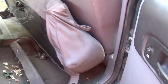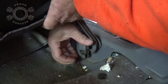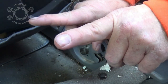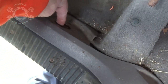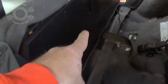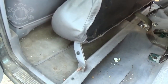So the next thing we're taking out right there — to take the seat out of an XJ, take your hand, pull up on that lever right there, but you want to kind of support some of the weight. Then lift that out of the way, go to the other side and get that one out. Since you got that side unlocked, slide it over because right there it just rides on that pin that goes back to the side of the hole — super simple. Unclip that and the seat goes that way or this way, whatever. So to recap: push the button, unlock it, pull it out of the hole, and take it out of the Jeep. I got the house right there and a rust bucket behind me, so this is about to be interesting.